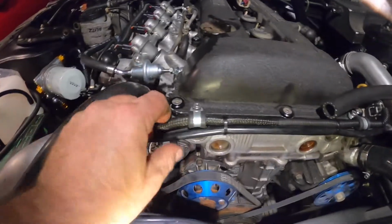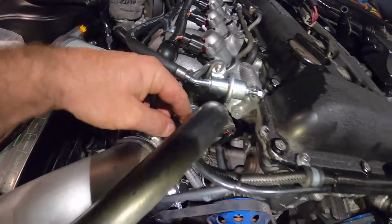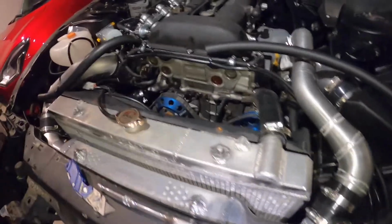I've just done the vacuum lines from where they come out here in the front and in the throttle body there. Then all the back lines, and I've even rigged up the old charcoal canister here as well. So I'll just run those lines across the top there. Got some P clamps holding the cable in. Looks pretty neat. So I've just been finishing this off.